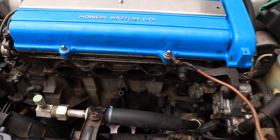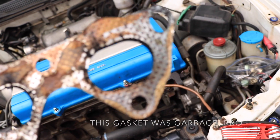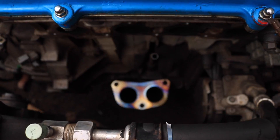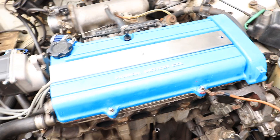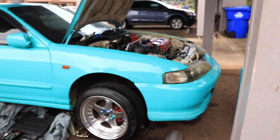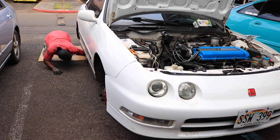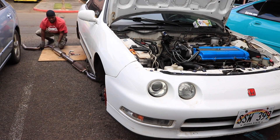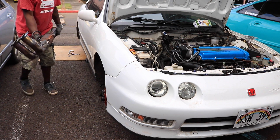Got the header off. As you can see there's a gasket still in there - there we go, the gasket's off. There's the header in there as you can see. I still got to take off the rest of the piping, the downpipe for the header, and disconnect that from the cat because I'm going to need the space to take the transmission out. I know the axle's going to have to come off soon but I'm waiting for that. I still got to take it off on Tiffany the same thing. Alright guys, I just took the exhaust off. Full exhaust - that's the header and the muffler.